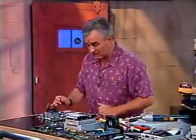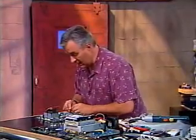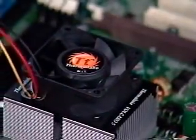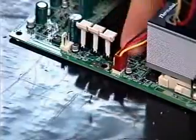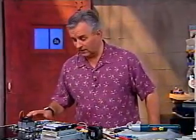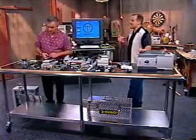You want to make sure the heatsink is making contact with the processor because you've got to draw the heat off — if this doesn't cool the processor it's going to burn up. The fan connects to the motherboard; sometimes a fan will connect to a power tail off the power supply itself, but in this case the fan connects to the motherboard on a connector near the processor that says CPU fan. Please, the first time you power up, look very carefully at that fan — make sure it is turning. If it's not, immediately shut off the machine. You will fry an Athlon in seconds without a heat sink and fan.